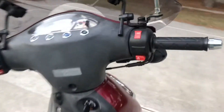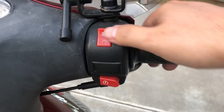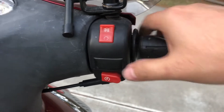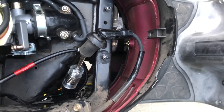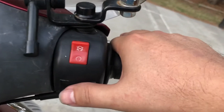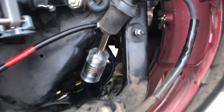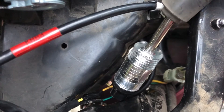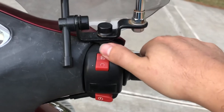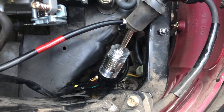Let's take a look here. I thought maybe the kill switch was the problem, but it's not. I'll demonstrate that the kill switch is in fact working. I have a standard tester for ignition, so I'll put the kill switch to on, hit the brakes, and when I do that the tester shows we are getting electricity to flow. So the kill switch is working. Now I'll reset the kill switch so it's off, and then switch it back on.